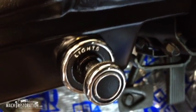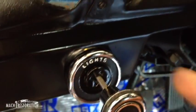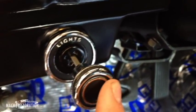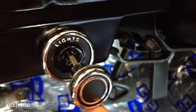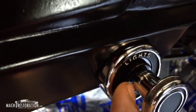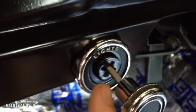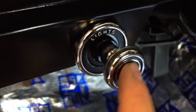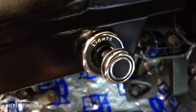Number one, the bezel stem that comes with the 1970 model Mustang and the knob looks similar, but it's actually only 4.5 inches. The one for the 71 through 73 is 5 inches. So at first glance everything's going to look like it's going to fit, but once you actually get it in here and try to snap it in, you'll notice there's not enough room — you're missing half an inch of stem. So you're going to have to remanufacture or refurbish your old stem, which is what I've done here. I simply removed it, sanded it, painted it, and installed it. You'd never know anything was ever wrong with it. That's the first problem you're going to run into.